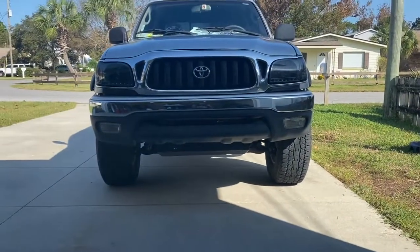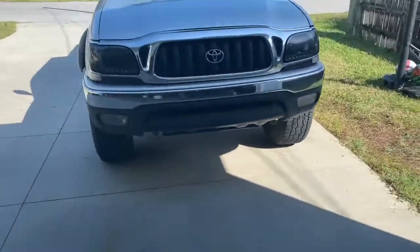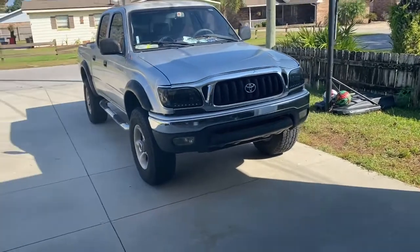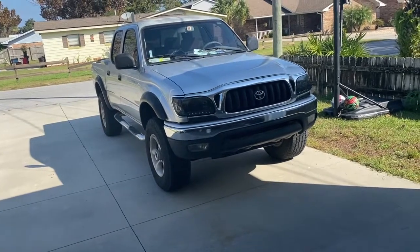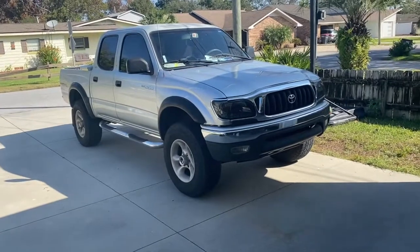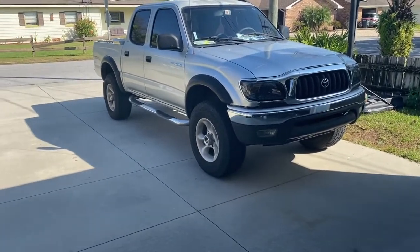When it comes to the double cab, my fair warning to you guys is purchase the Toyota 4Runner strut for your model. It really doesn't matter — it's the same from 95 to 04. This is on the pre-runner side. If your truck is not a pre-runner, you won't have this issue — or a V6, because the pre-runner has four-wheel drive suspension and the four-wheel drive obviously still has four-wheel drive suspension.